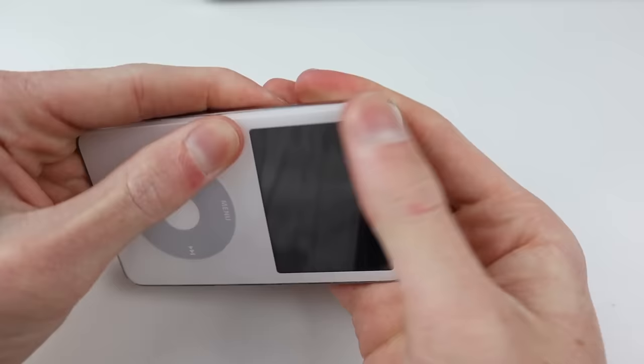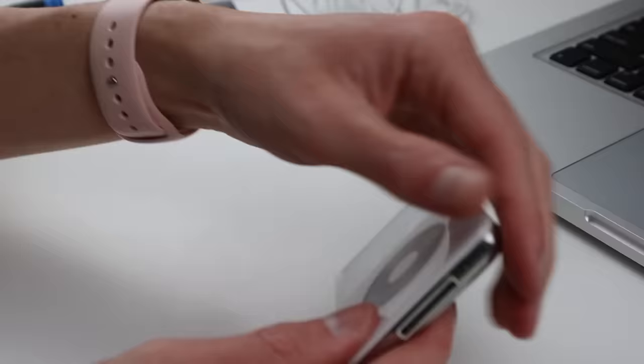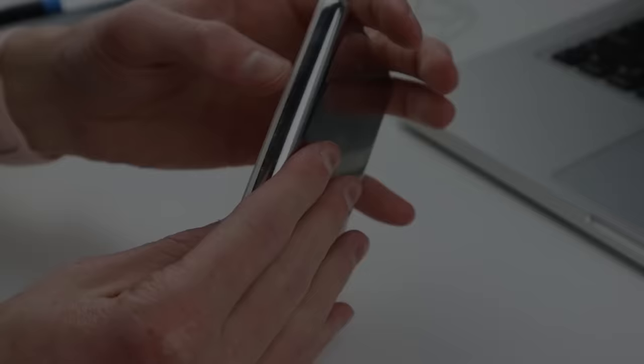It's time to clip in the top and we're basically done with the iPod — well, there was a slight issue. It wasn't closing properly. I found out the issue was actually those pieces of rubber which were adding just a little bit too much thickness for the compact flash card. With those removed, the iPod sealed up just fine.